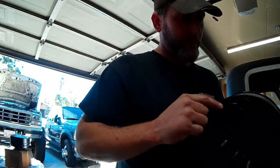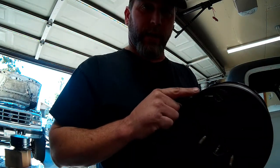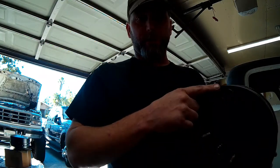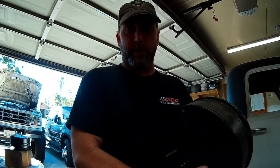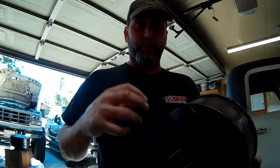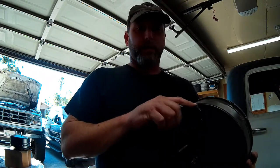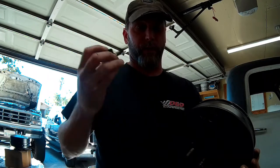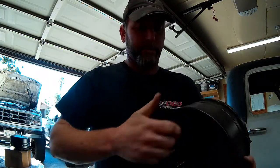This valve is your check valve — it's a one-way valve. Vacuum comes in and can pull from the booster, but it doesn't allow air to go in. If these fail, you won't get any power assist. I checked it when I diagnosed that the booster itself was bad — I pulled the hose going to the check valve and made sure I had vacuum coming from my vacuum pump, because the 7.3 diesel doesn't make any vacuum from the intake manifold. It has an external belt-driven pump that provides vacuum for these accessories. I also pulled the check valve out and checked that vacuum was going through it and the valve wasn't stuck. If you have vacuum at the hose and your check valve is working, you just have a cracked diaphragm or bad seal in your booster.